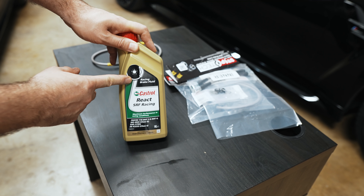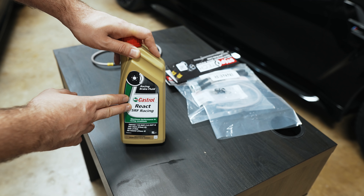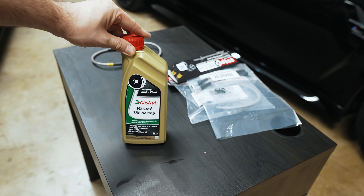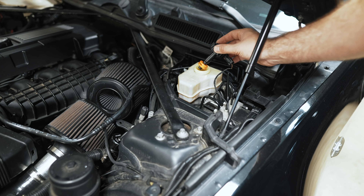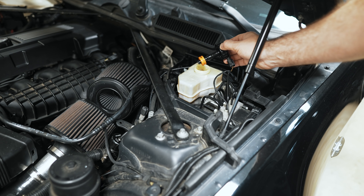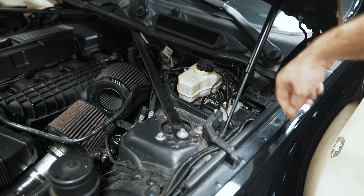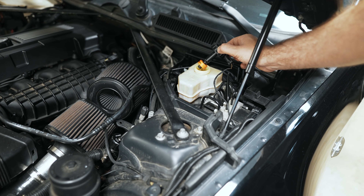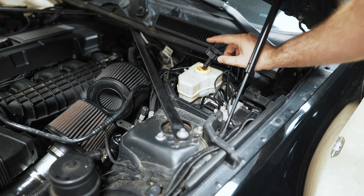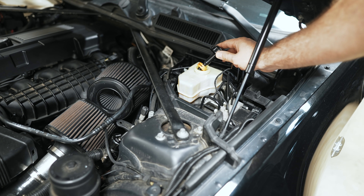What makes a racing fluid different from DOT 4 or DOT 3 brake fluid is that the dry rating — in terms of how much heat it can tolerate before it starts to boil — is going to be higher. But there's something special about this fluid that makes it really unique. Brake fluid has glycol in it, which is in the alcohol family, and alcohol naturally absorbs moisture from its environment. Think of electronics cleaner — you use alcohol to displace water off a board. So after about two years the fluid has to be changed even if you haven't driven your car, because it will absorb moisture from the air. You may get less life expectancy in a really humid environment depending on how much moisture is available for it to absorb.